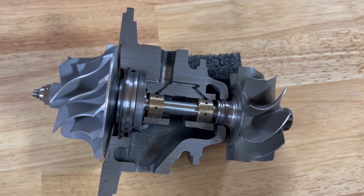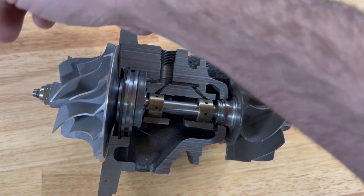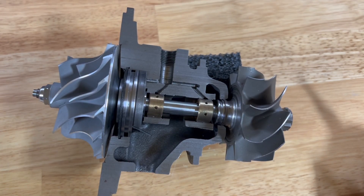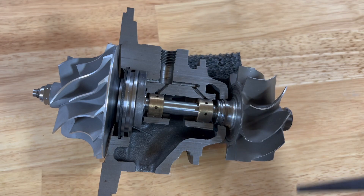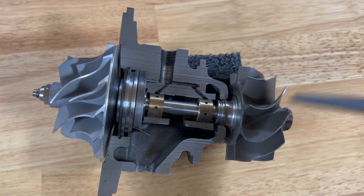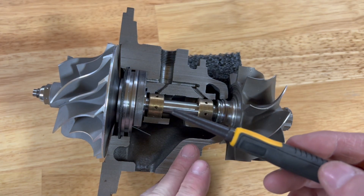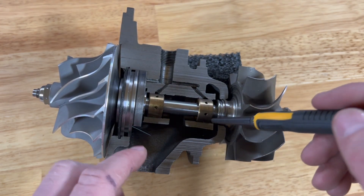Regardless, there has to be some sort of ventilation system on the truck. Most newer vehicles have ventilation that feeds into the front of the intake, so the oil gets sucked in through the crankcase vent and that air pressure comes into the front and just gets sucked up. That's actually one of the best ways because it provides negative suction — a vacuum on it — and that prevents any pressure from building up in the oil drain. When your crankcase vent is not ventilating properly, that pressure builds up in the oil drain and will push the oil back up and not let it drain, since the drain is gravity fed. The air pressure will literally push it back up and eventually push out the seals.